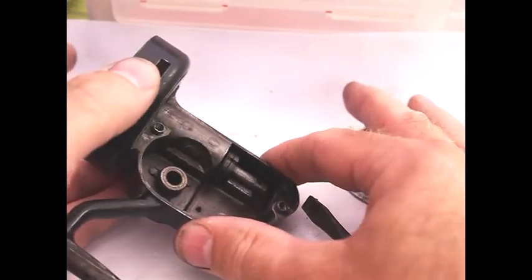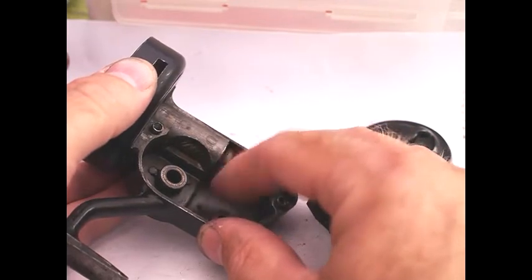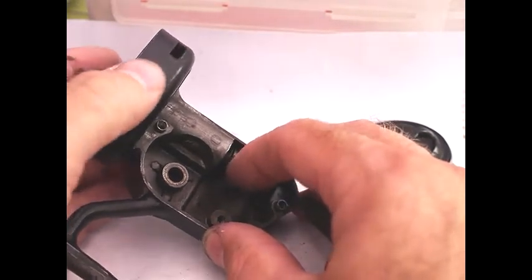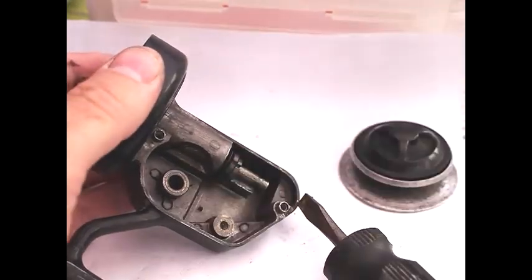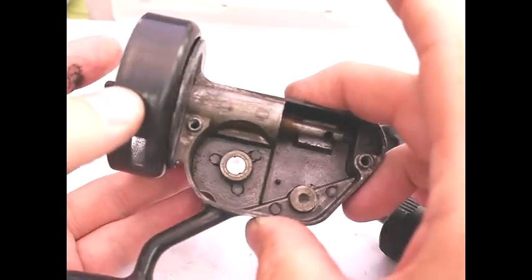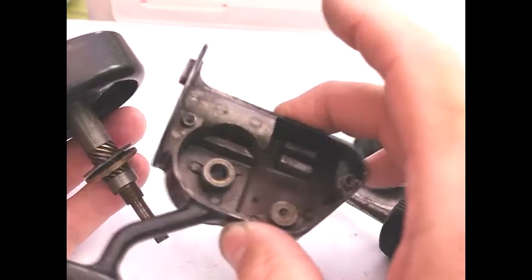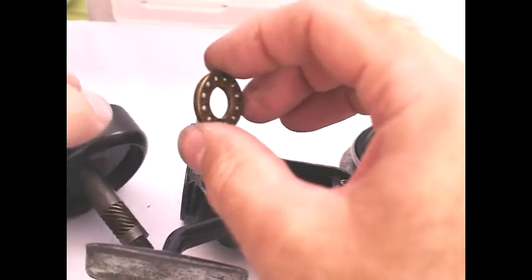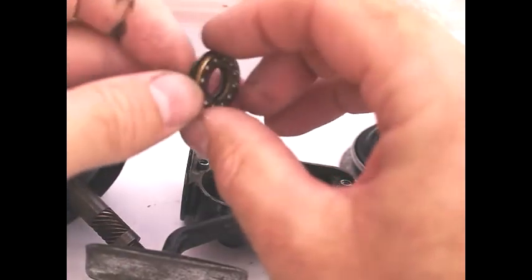You've got this last piece here, and you need to take these lock washers off. There's also a little fibre washer you can just see there, which also needs to come off. Once all that's off, you can then slide the slider out. And you can see the bearings have just dropped down there — there are three more parts to come off. You can see the bearings and a flat washer upon which the bearings run. You can actually turn that washer backwards when you do reassembly, if it's a bit worn.